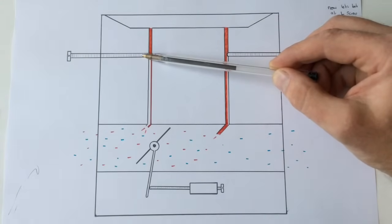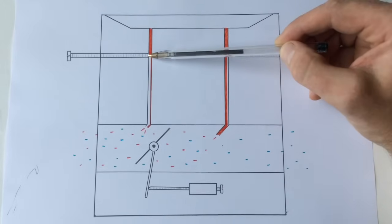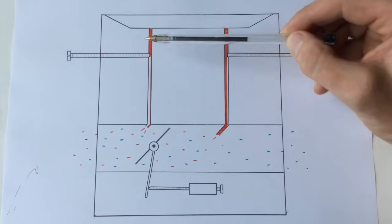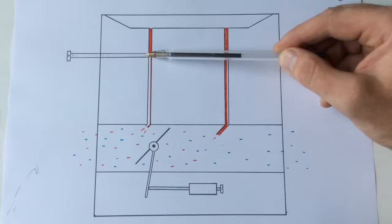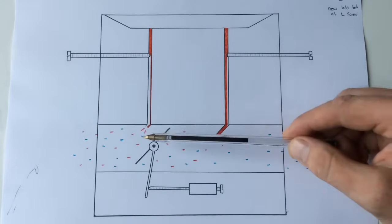...and then I'll adjust this screw either in or out and listen to the engine as to whether or not it's sounding efficient. As you can see here it's letting a certain amount out at this point - because remember this is still on one turn; we haven't adjusted this one yet, we only adjusted the high screw.